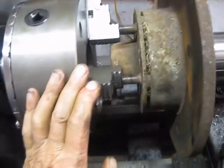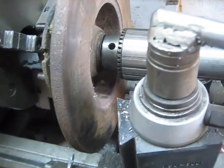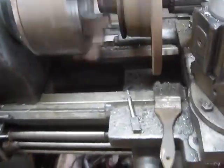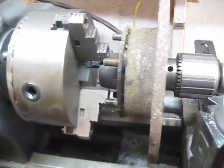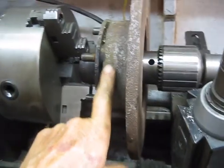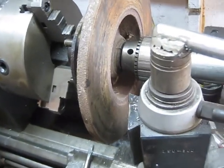So here it is. I can't really get a good grip on the hub and I've got a big chuck in there. Let's see how straight it's running. I'll have to put my dial indicator on there and try to center it up as best I can. Looks like I might be able to put my jaws around and chuck it on this. I'll try to do it like this first and see how straight I can get it.